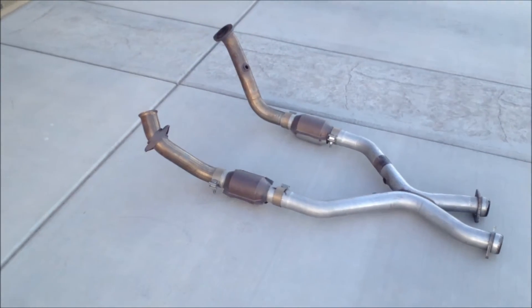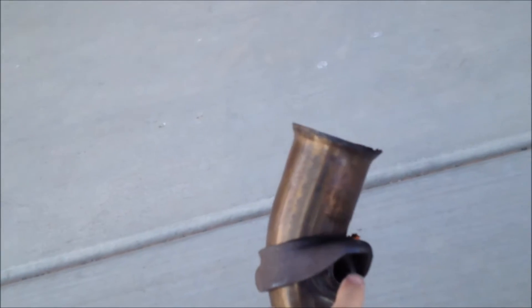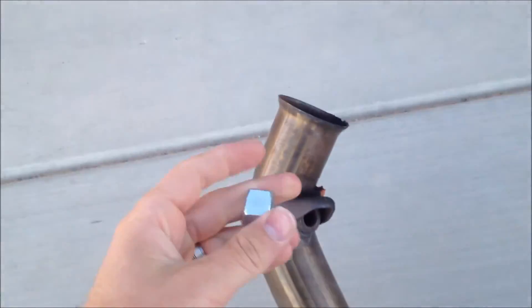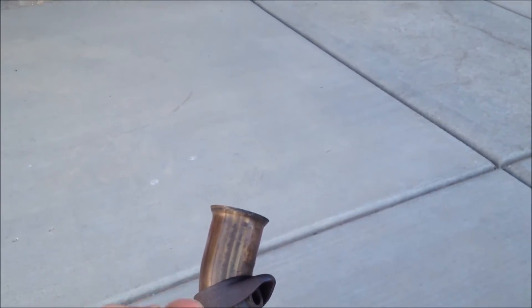The location and position of this is very important for accuracy. As you can see, this is where the O2 sensors are on the car at the top here. Where you need this bung to be installed is about 24 inches downstream from the exhaust ports on the engine.